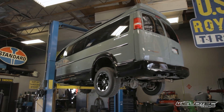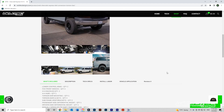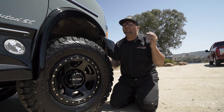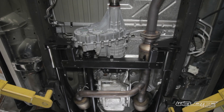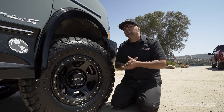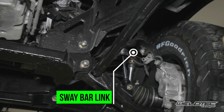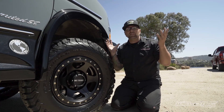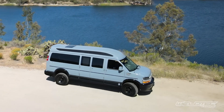On this particular van we did go to four wheel drive, and this does have what is called our torsion bar conversion. This is a conversion similar to what you would see from some of the other manufacturers, where it's going to use truck components in order to convert it to four wheel drive. However, it does come with a long list of Weldtech fabricated parts such as the drop cross member, the transmission cross member, and a whole bunch more. We also put our Fox shock on the front of this, and some really nice sway bar links as well to allow you to get that full articulation without anything binding up. Overall this kit is really nice.